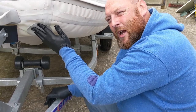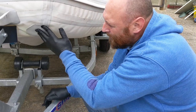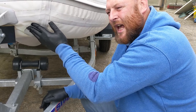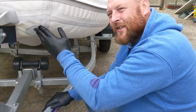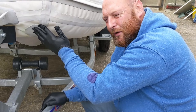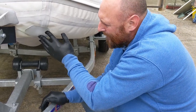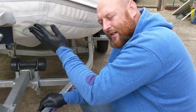It might take five to ten minutes depending on how much hardener you put in. Once it's hardened to the point where you can leave it, I recommend leaving it for about 24 hours before fully inflating. Don't give it just an hour or two — it probably will hold, but if you want this to last you need it fully set before putting any pressure on it. Once I get it to the point where I know it's not going to peel at the edges, I'll leave it overnight and come back tomorrow to fully inflate it and check for leaks.